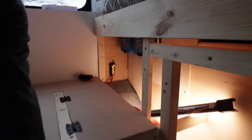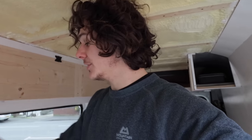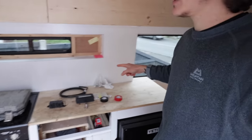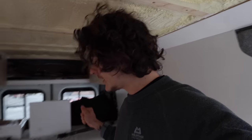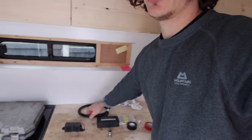It's been a long old night, but here we go, day 2. Seeing as it's now Monday, we can get ourselves down to the DIY shop and get ourselves the little extra bits that we did need, which are for connecting the wire to the wall down the back of the unit. And also, now I'm thinking, I'm going to need some extra 35mm wire or something just a little bit less, so I can connect the negative bus bar to the earth and also the positive bus bar to the batteries, because at the minute I've only got this stuff. And although it's over a short distance, I want to go a little bit thicker just for peace of mind.